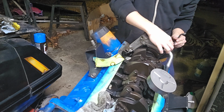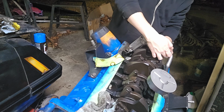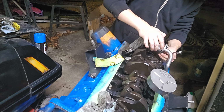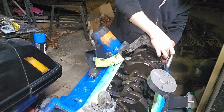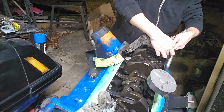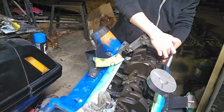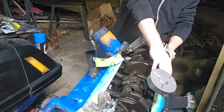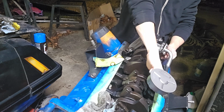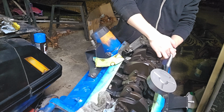When I do this, I'm taking my time. I'm not just running the bolts in. I'm feeling that the bolts are lined up correctly. This one's not even in. Make sure that they start in that pump. They're not crooked. They're not getting tight on me. Because this right now is on a bind. Even though I only kept this finger tight, it actually is binding.